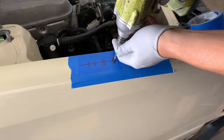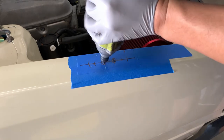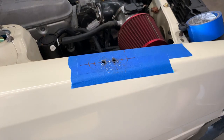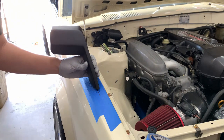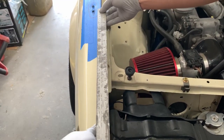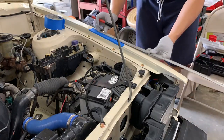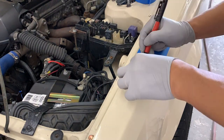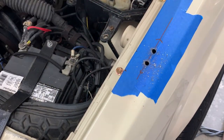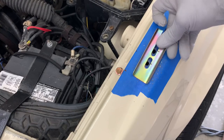Let's drill some pilot holes here — one, two. Punching my fender. Moment of truth. We got a fender mirror, flush with the flange. We can even measure with this ruler where the far hole is — it's about 15 and a half inches. So if I do about 15 and a half inches on the other side. I got both sides drilled out. I just marked where the holes were on the other side, flush against this line up here, and made the same exact holes.